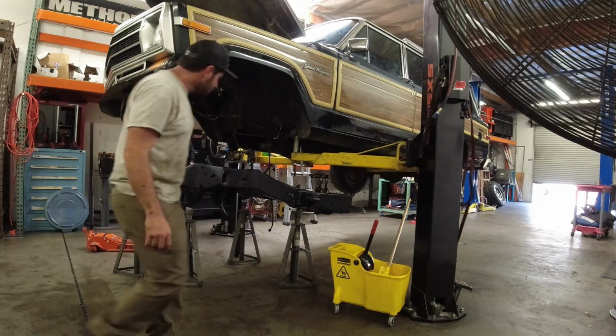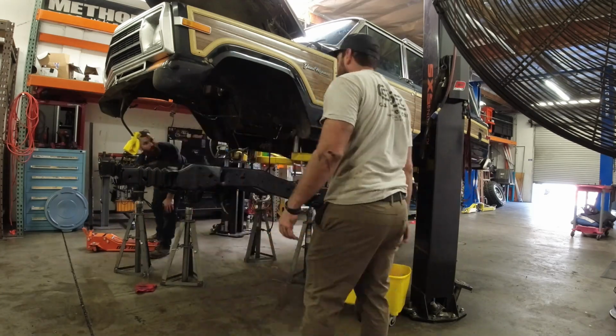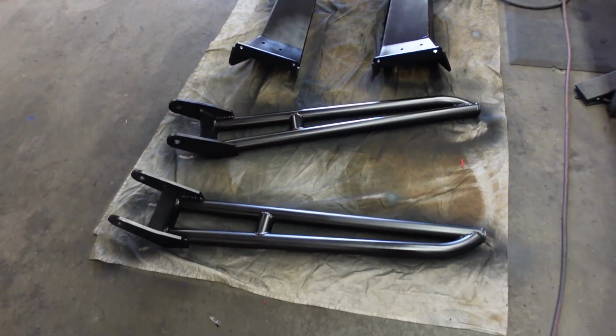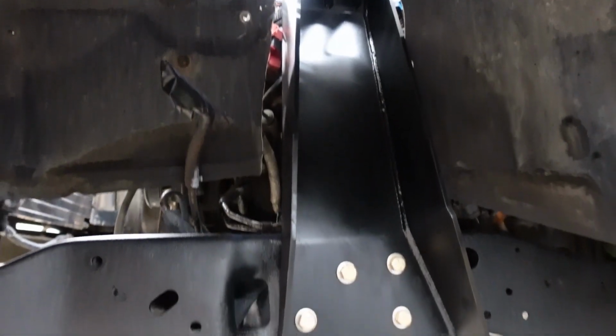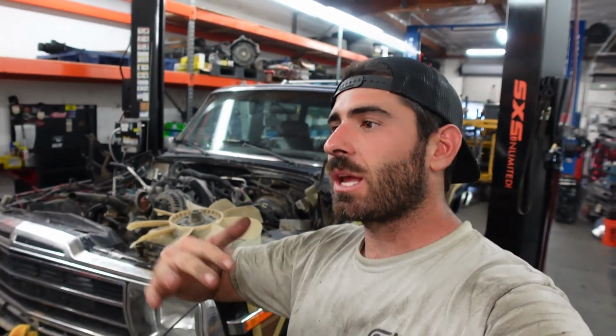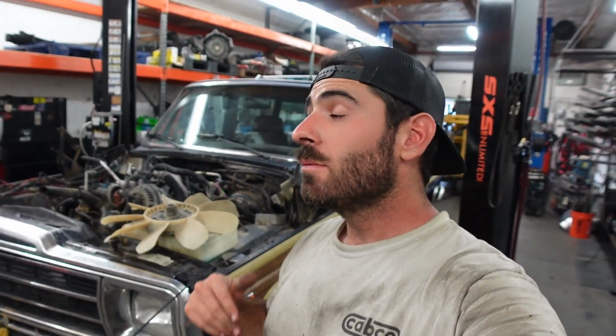So, Jeep build day two. We got a lot done. We got the frame in. We got our coilover towers bolted in. We made motor mounts today. What else did we do today? Doesn't seem like a lot, but it was a lot. Super excited about the coilover towers. And then next week, we're gonna start cycling the front suspension, making sure everything clears correctly, potentially getting some tires on the front of it, get it rolling. We gotta connect steering, but we're doing great.